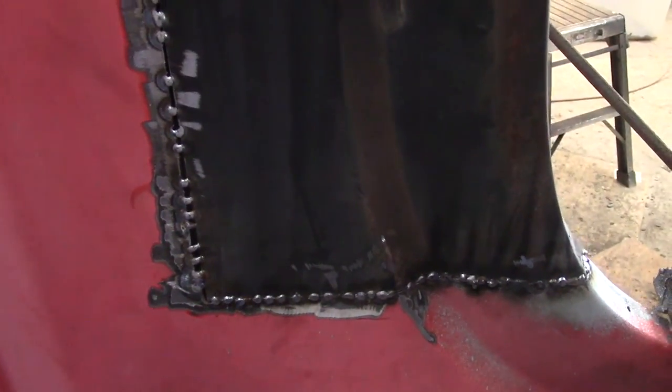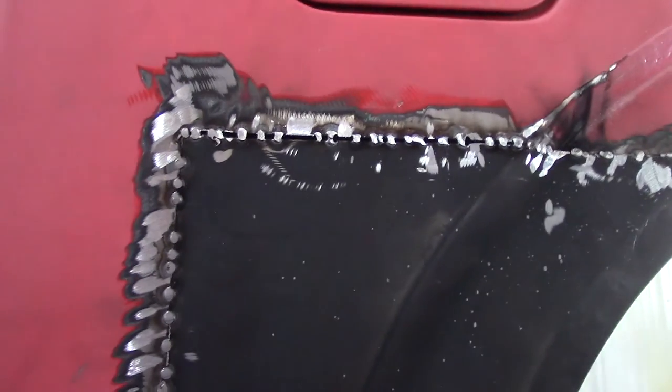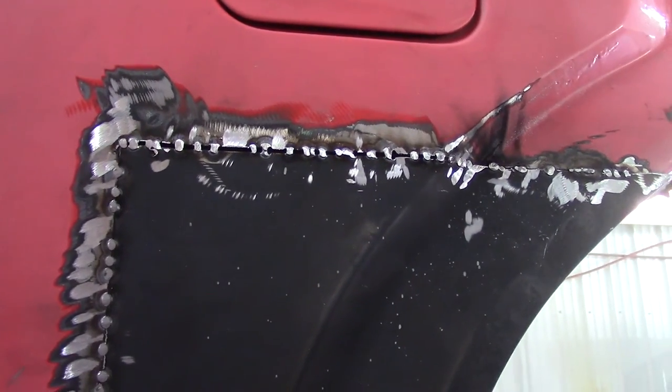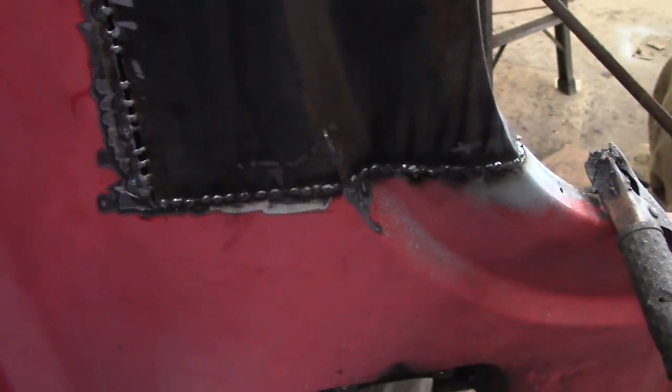It's a good way to get a driver back on the road — get it solid. I'm going to finish filling all those spots, grind it off, and there'll be just a nice thin band of Bondo through there. You'll never notice Bondo. The thing is, the more you warp it the thicker your Bondo needs to be, so less warp is better. Looks good enough — I'll let you do the Dodge.